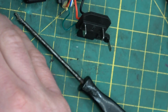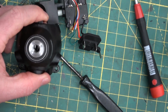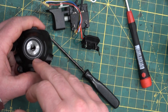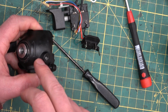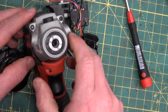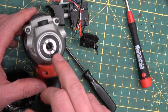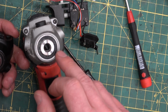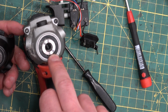The interesting thing about commodity items, when you're talking about bearings and minimizing friction, when you're talking about tribology, is you're more worried about cost than anything. You want the most bog standard bearings, what you can get your hands on. In this case, the Milwaukee on the front side has a big beefy bearing, and it is very likely quite a bit cheaper than this oddball one with the thin cross section. Just by account, they'd be using more of the other things.